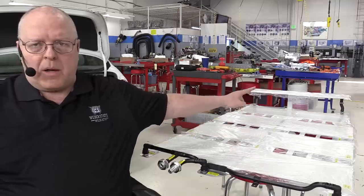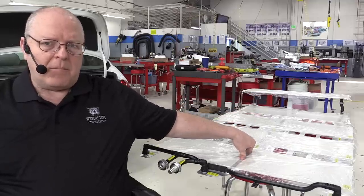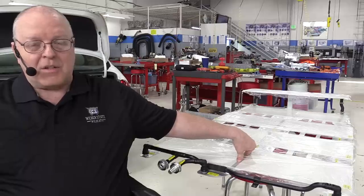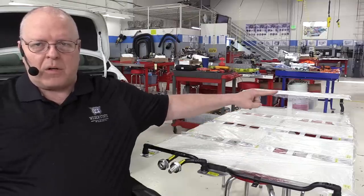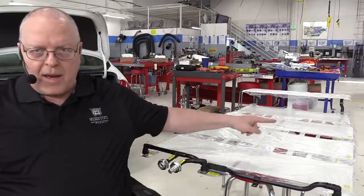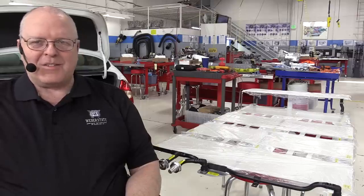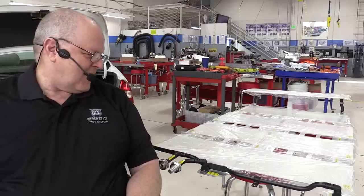The upper coolant plate back there, though, for battery section number 5, that plate would have to be removed if you were going to replace any of the following battery sections 3, 4, or 5, because you have to remove battery section 5, the one on top, to get to battery section 4, but you cannot get battery section 3 out without also taking out battery section 4. So hope that you don't have a bad battery section 3 ever, because it's a lot of work. You've got to take everything apart pretty much to get that one out.